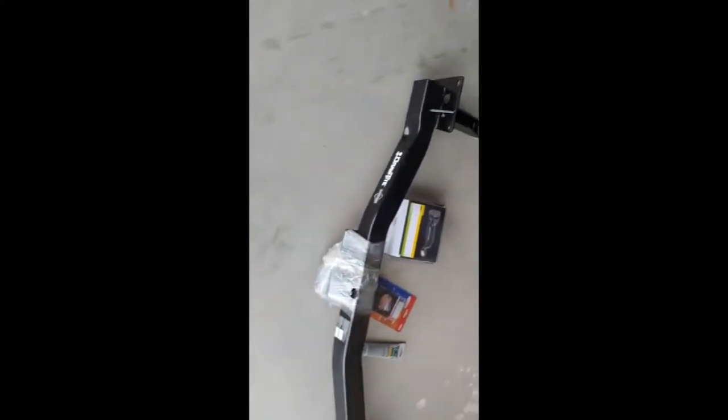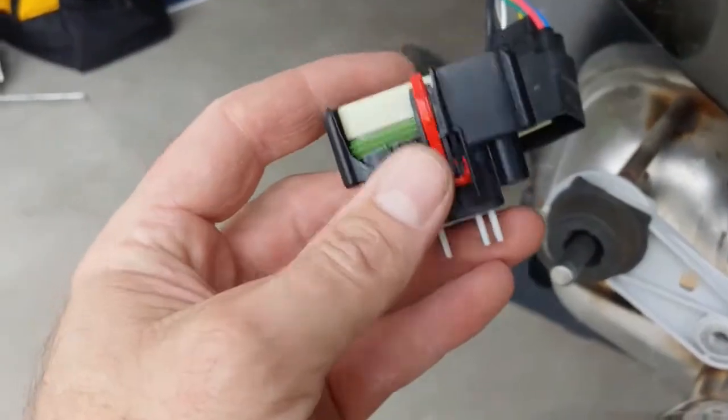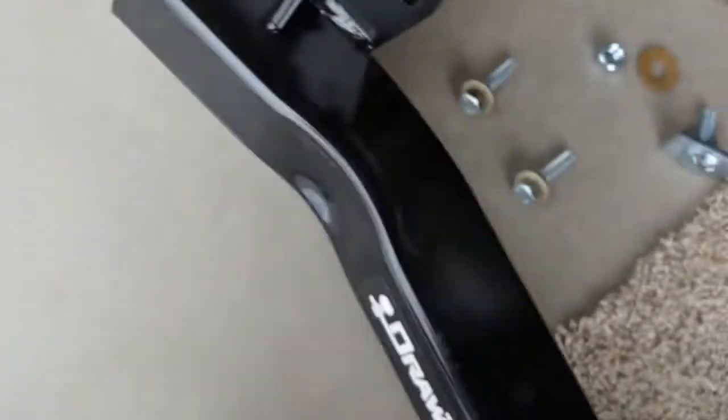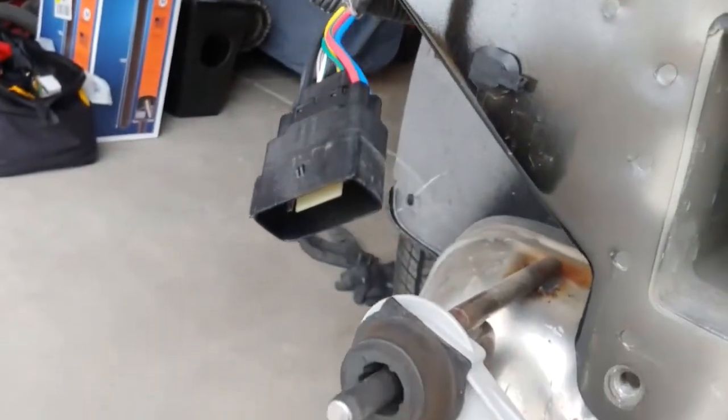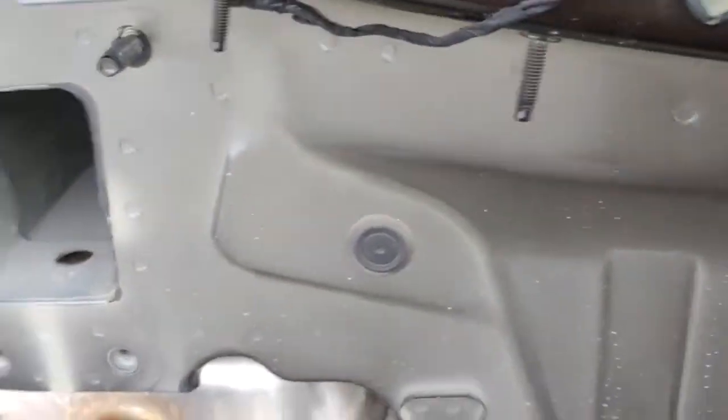The bumper is over there — that's what it looks like when you have it taken off. It actually came off pretty easy. Our hitch will be in the opening there and you can still use the cover. Now we can install the DrawTite. For the wiring, you just take off this cover — it's just garbage — and take your wiring connector and simply plug it in. Then we'll have it coming out to the hitch opening. I'm going to plug this in, slide the hitch in, and get it bolted on.